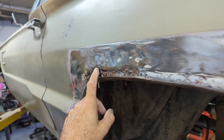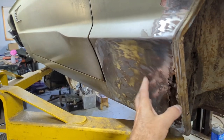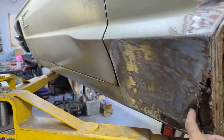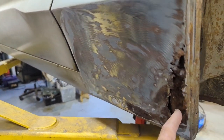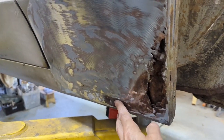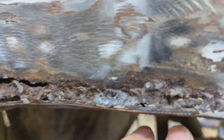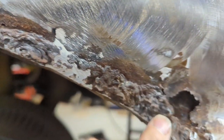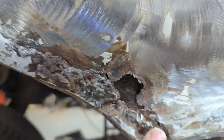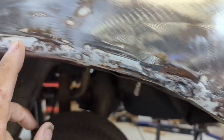There's a small bit of work to do on the wheel arch lip, inside and out. Down here, there was some filler that was starting to pull off — and that's what was underneath it. I don't believe this was rusted; when they did this work I think it was just damaged. They did some pretty poor bodywork. You can see the welding on this — it looks like they just used arc welding or a MIG welder to fill it; it's all bubbly. Of course moisture got behind it because they didn't seal anything, and it rusted it all.